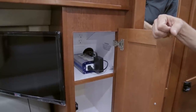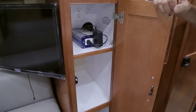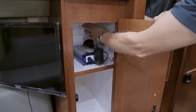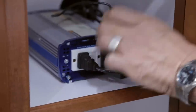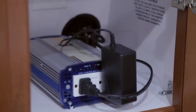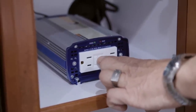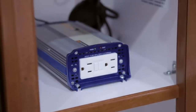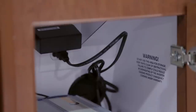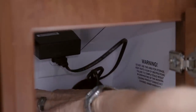Both the TV and Blu-ray player are 110-volt systems — they must be powered by the onboard inverter or by shore power. Unplug the television and DVD player and insert the plugs into the outlet just above the inverter. The inverter has an on/off switch and a cooling fan at the opposite end of the plugs — you can turn the inverter off to eliminate fan noise. If you are not getting power through the inverter, check the reset on the GFI on the inverter and ensure the switch is on. When on shore power or generator, the TV and DVD are plugged into the wall plug just above the inverter with the inverter switch in the off position.